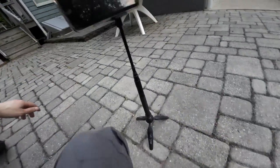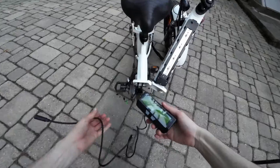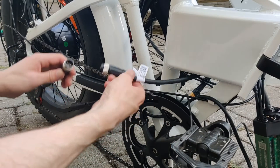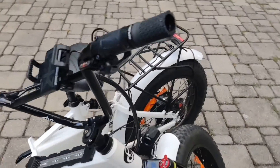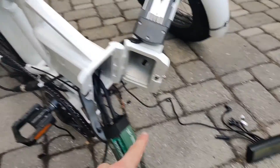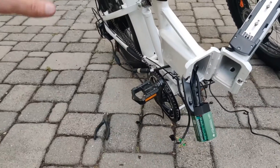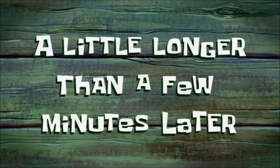While the controller is hanging out like this, this might be the easiest time to plug in the main 8-pin Cycle Analyst connector. It's a secure, watertight connection. I just got to get this XT60 battery cable connected. So I got all the main things connected — I actually widened the old charge port in order to get the new battery cable to go in that way. So now we have the motor connected, the battery connected, and the Cycle Analyst connected. Now I have to connect the programming cable to this motor, raise up the back wheel, let it spin, and calibrate. And then once I confirm that everything works, I can officially put it all together.